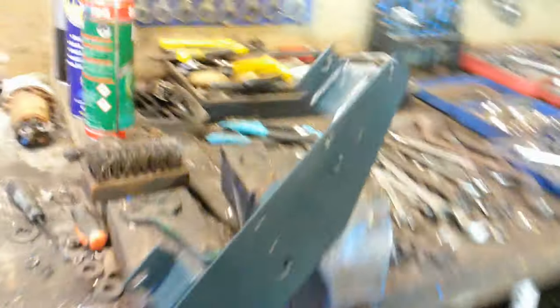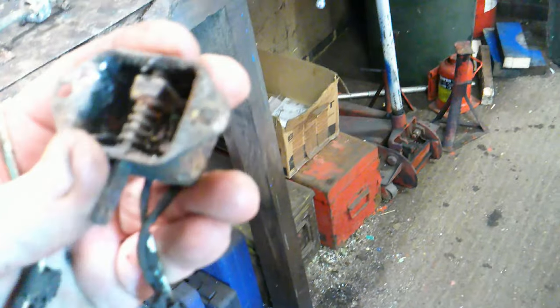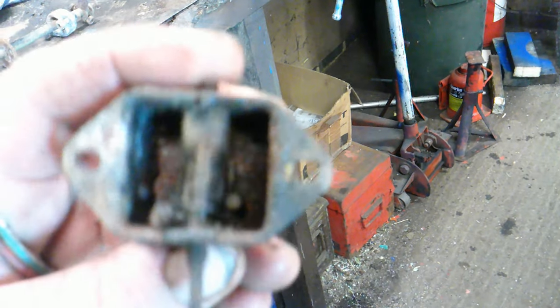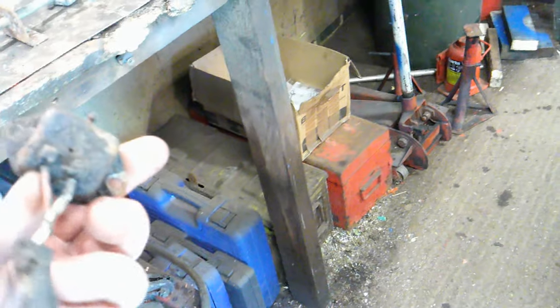What I'll do is get these bits made up that I've got on the desk and then show you when it's all back in place. Just bolt bits on here, put them all back in place. I'm not going to do any of these bolts up tight because I know all the wiring loom disappears off behind here, so I'll just put it all on temporary. This can go on permanently and I might even stick the carburettor on. Let me just see if I have the brake switch to hand — there's the brake switch. Literally bolts up in there, the spring attaches to that, pulls it and just makes contact inside. There are two little bits inside that touch on the two terminals.